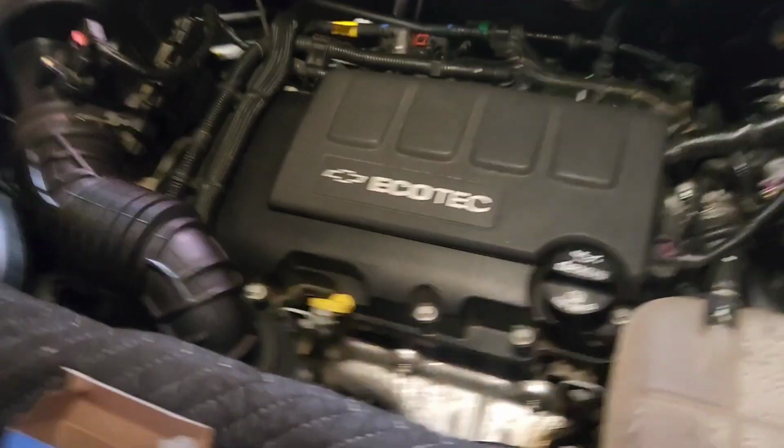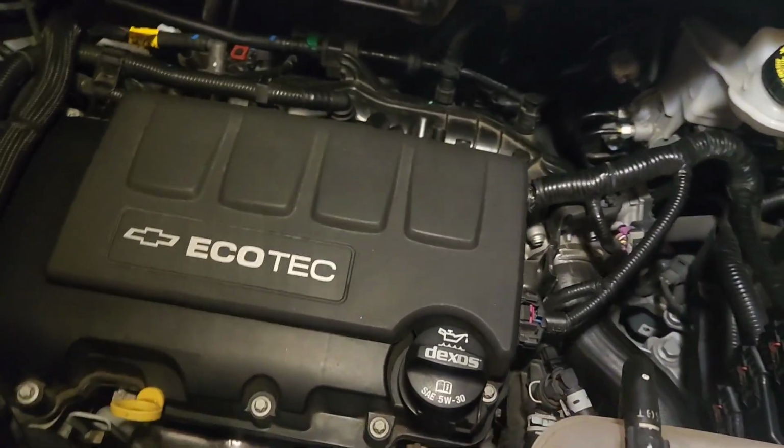We're a little under that, probably around 4,700 miles. So we're about 300 miles earlier, probably 320 miles to be exact. And I'm curious to see how that oil filter looks. Okay, without further ado, let's grab my stuff, and I'm going to go up front and begin to do the stuff. Okay, our gap was correct at 28 thousandths of an inch.